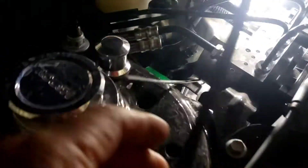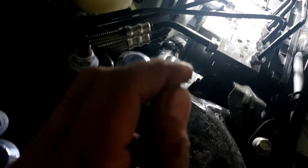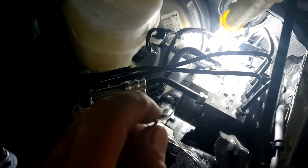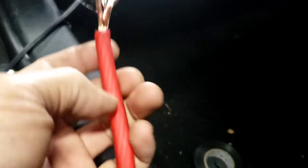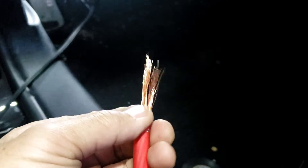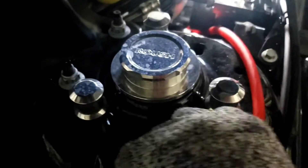Here's a trick for running this power wire — you see that hole right there on the bottom? I use an electric tape feeder, cut to about three feet, and tilt it up a little from the driver side. I cut about three inches, split it in half, stick it in this hole right here, tape it up, and spray some WD-40. Now I've got the wire coming out — just keep pulling it through.